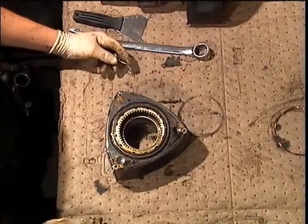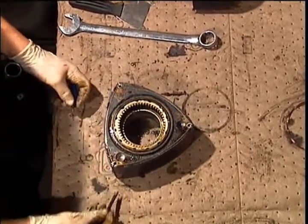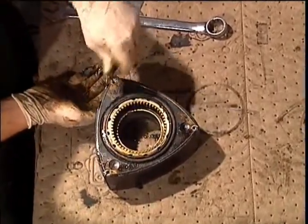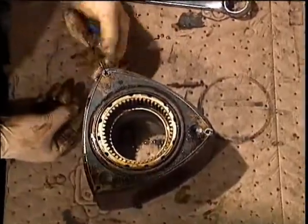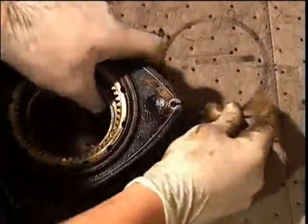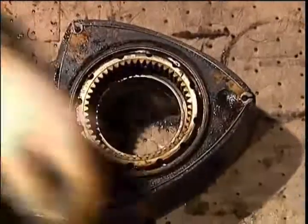When picking apart the rotors and their seals, don't worry about tracking the location of each part. Most of the seals are very similar in size and may need to be replaced anyway. Use caution when handling these parts. They are very sharp and may cut you. Be sure to get the springs and all of the carbon out from under the side seals.